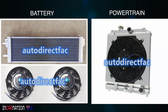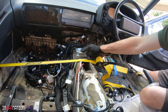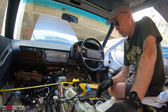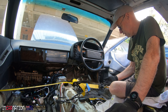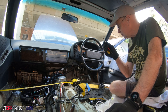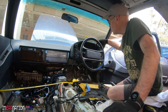So that's two cooling systems — one at the back for the motor and one at the front for the battery. There's been a whole lot of background work happening: extending looms, wiring, repositioning things like the crash module. One thing I've done today is connect the two electrical systems together — we've got the MG system, but we also have the legacy electrics from the Porsche for blinkers, hazards, brake lights, park lights, electric seats, windows, and central locking. All that stuff is still Porsche.